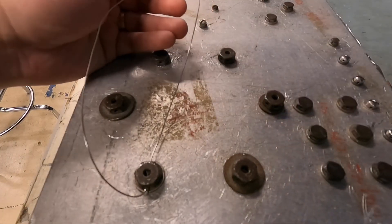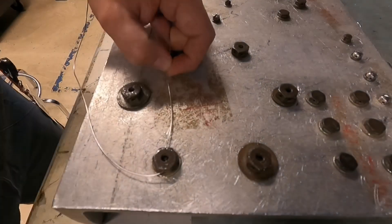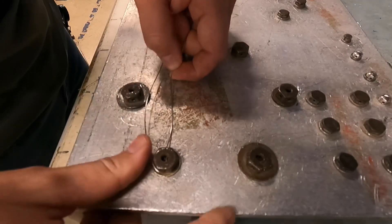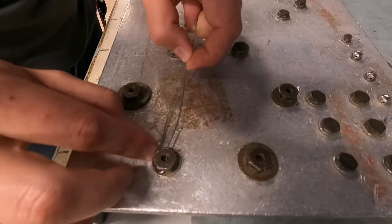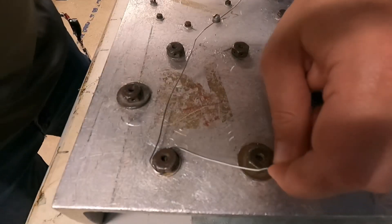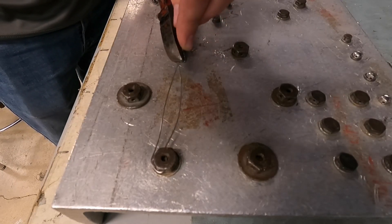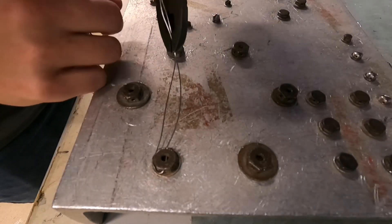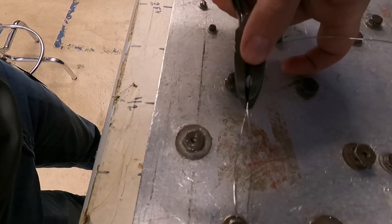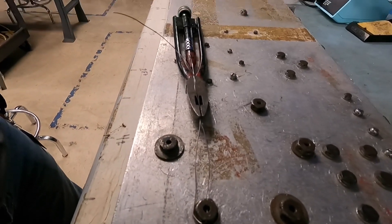For this I'm using 032. I'll start by putting my wire in here and then pulling it around, making sure that I have about an equal length in both hands. Now that leads me to my second tip: I'm going to push this wire around with my hand and sort of push it up against the bolt hole to help tighten it and make this little bend. Then I'll grab this strand coming out of the hole and go over to the next bolt and pinch it with my finger to mark about where I want to end, grabbing just a little bit further because the wire will shrink as I twist it. You want to make sure that you clamp it with the open end of the safety wire pliers — if you clamp on the other side you can accidentally cut them.